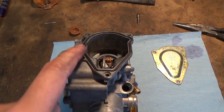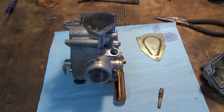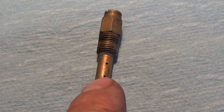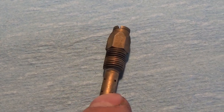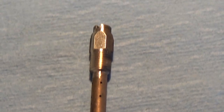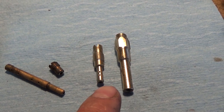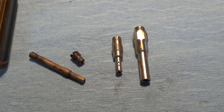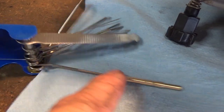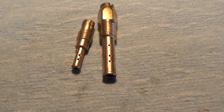The carburetor is blown out and I've replaced the o-ring — just wiped it off and we'll get the top plate back on. I'm taking all the little jets to my wire wheel to clean them up — going from something dull and rough to something shiny. A shiny surface helps keep dirt and debris from sticking. I'm using the brass wheel on my bench grinder. Then get yourself an oxy-acetylene tip cleaner and poke through all your metering rods and jets — you can get the really small ones to go through smaller holes.